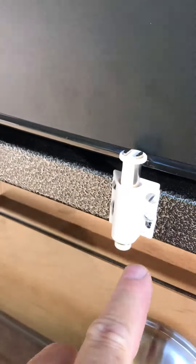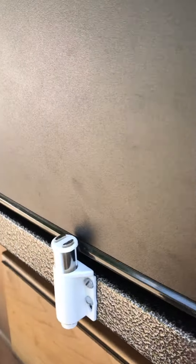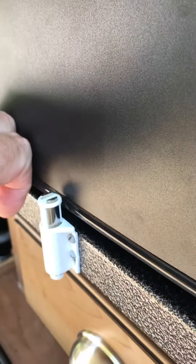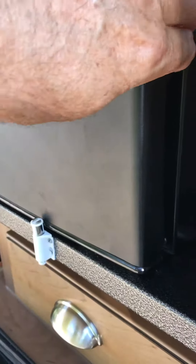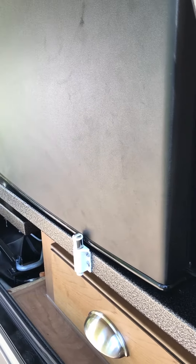So I just drilled and tapped some 6-32 screws. I have like two or three of these things left over from an old medicine cabinet. You just push in a little bit down, and there's like a 1/16 inch clearance. When you get ready to leave your destination, it can't come open at that point. Now your stuff, whether it falls around inside or not, there's other solutions for that, but this will keep the door closed.